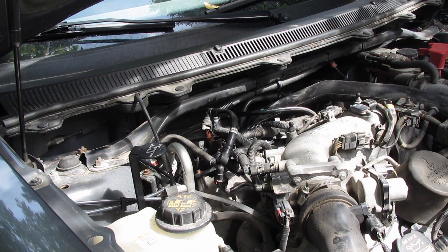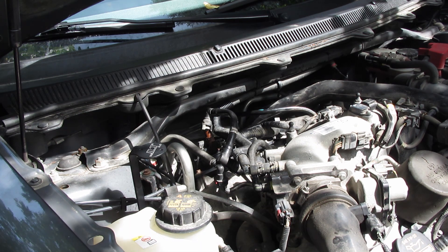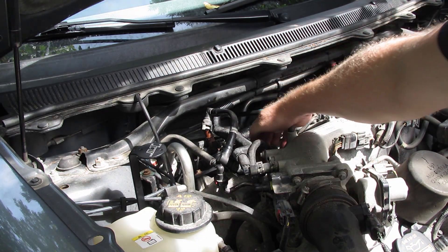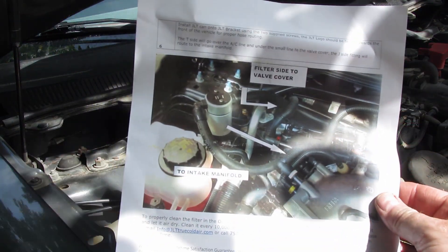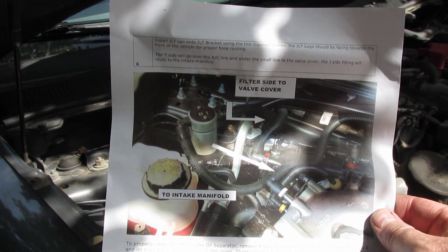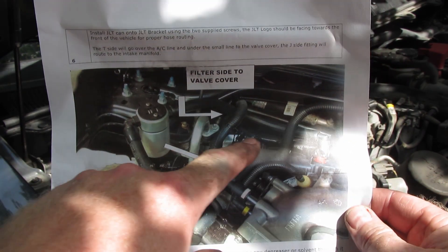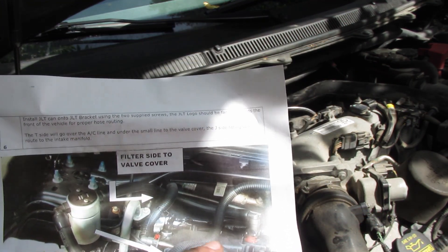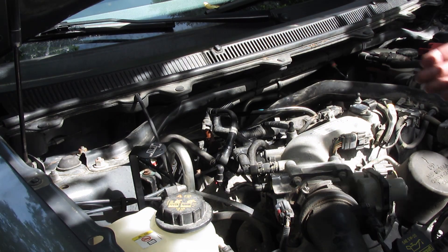The reason I'm making this video is that the 2010 design is different than the newer Ford Flexes. You can see that's actually an aluminum valve cover, whereas in their drawings and in other videos I've seen for Ford Flex SHOs - super high output - it's actually showing a plastic valve cover with a red nipple sticking out way back past the intake manifold.